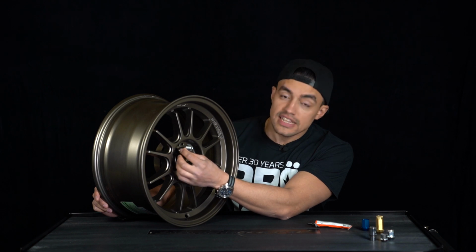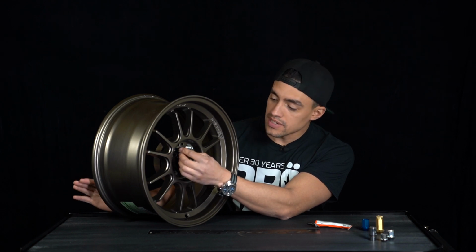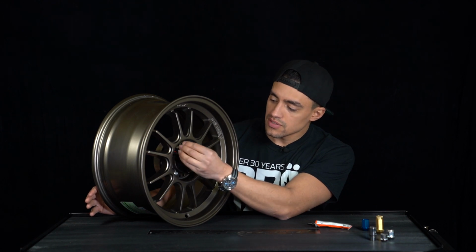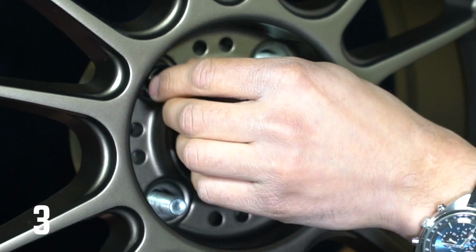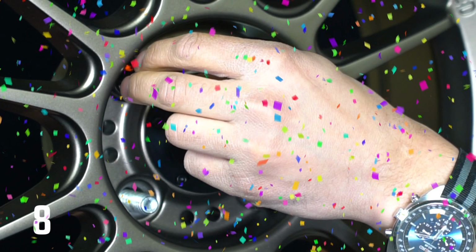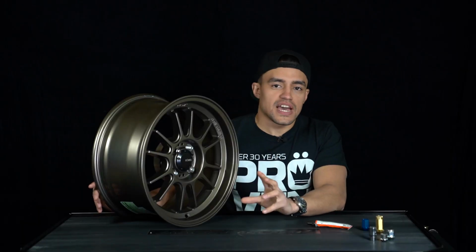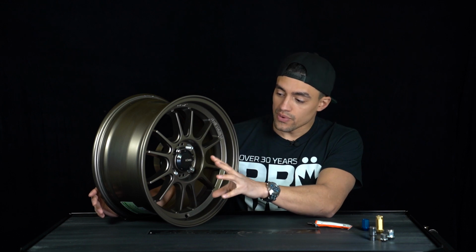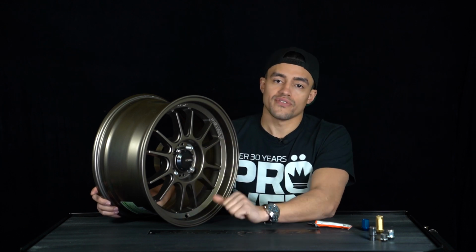All right. Now that it's catching, I'm gonna twist it. And remember, I said it was gonna be about 7.5 to 8 turns. So I'm gonna start twisting it. That's the first turn. 2, 3, 4, 5, 6, 7, 7.5, 8. Just off of that, I know that there's going to be enough thread engagement in order to get the proper clamping force to prevent this wheel from rolling off of my car.